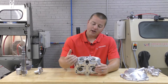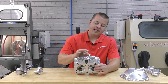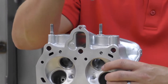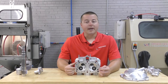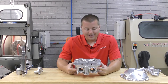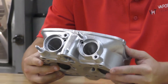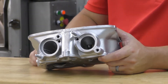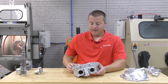We were also able to clean a steel stud — clean that thread — so that we get accurate torque specs when putting parts back together. This part has actually been clean now for about two weeks sitting in our showroom. The humidity isn't always great in here, but the part has held up very well with no post-treatment to prevent corrosion, and there's no corrosion evident on the part — so we're excited about that.